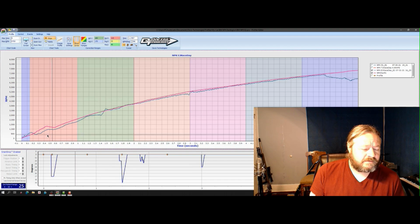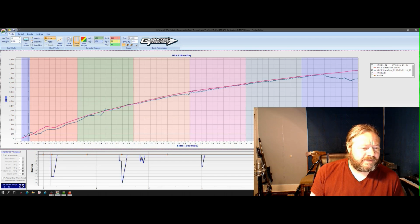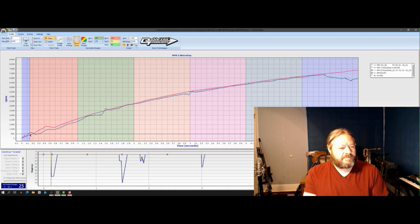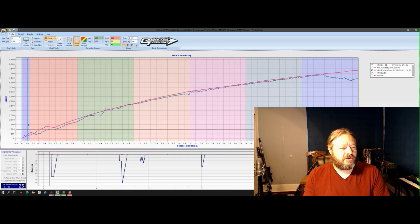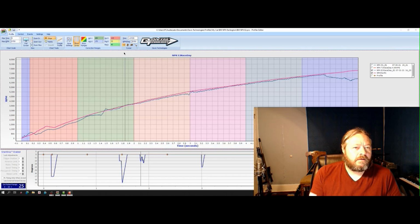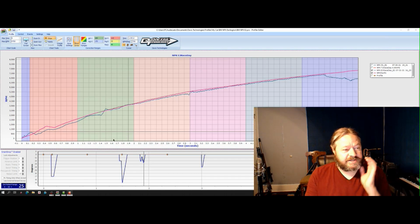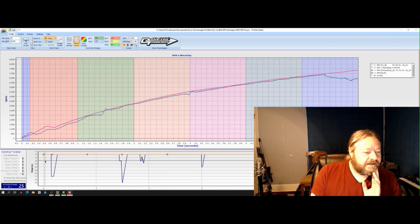As predicted, our wheel speed is down because the track is way tighter, right? It snaps the tire just a little bit right here. In the profiler, generally speaking, in the first tenth and a half or so, I generally make a dead spot where nothing is happening. We're not doing any corrections. So right here, nothing, even though we're above the profile, nothing happens.